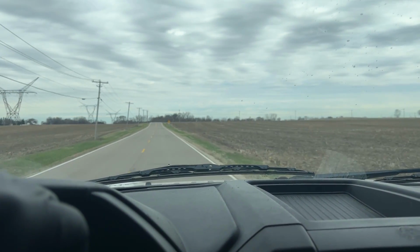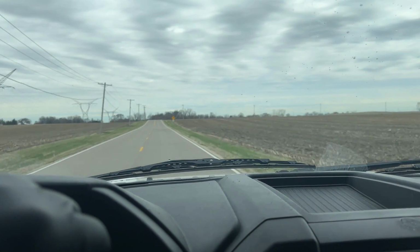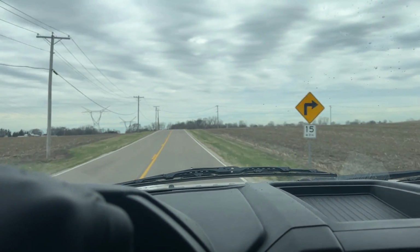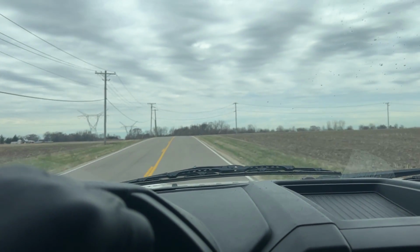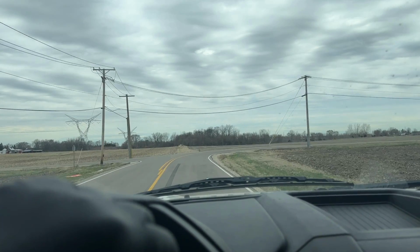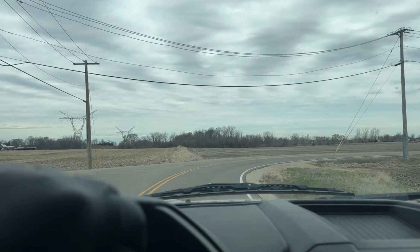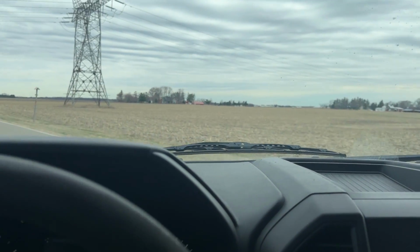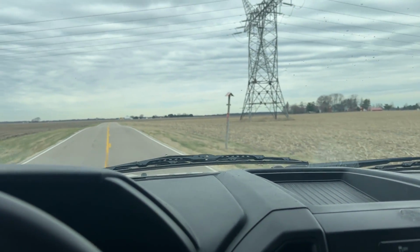But I mean, either it wasn't changed in 200,000 miles or there's something else going on there. I let them know. But for right now, you guys can't tell it, but I can. It's shifting like a dream. So we have new fluid in there, new filter, everything all cleaned up, renews the additive package, and we're good to go. So now we're learning both the trans and the engine shift points on here. Just go for a ride.